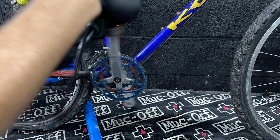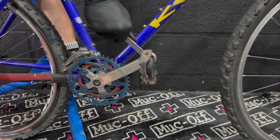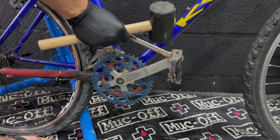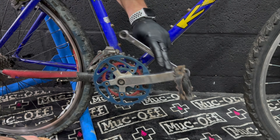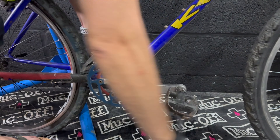I was worried about putting the chainrings through my knuckles, which isn't a good look. So I decided to get the heat gun out once the WD-40 had evaporated, and give it a good blast. Still not going — it was properly on there solidly. The spanner actually started to get dented where I was leaning on it. So I got the heat gun out again, knowing the spanner was ruined, and decided to use a mallet against the spanner. This is something I would advise against generally — bad advice, do not do it this way — but it works.